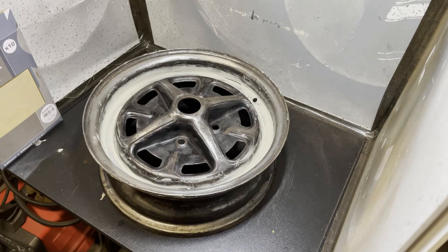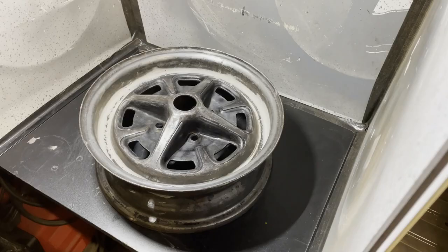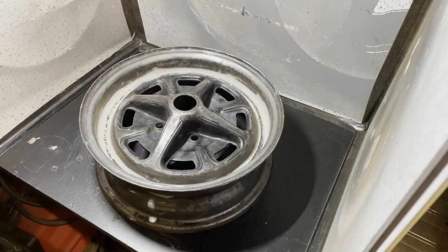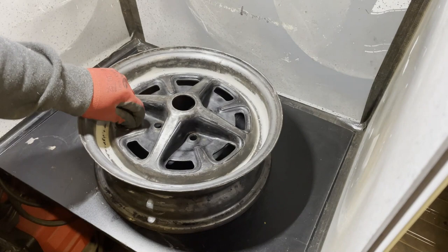The filler is on, and that's why everybody should have a mixing board in the garage — doing a lot of bodywork, fresh one, start again, brilliant. Two hours later — that is the filler all sanded back as much as I can. It is really boring so I've spared you the boredom with a time lapse. What we're going to do now is put a coat of primer on it.